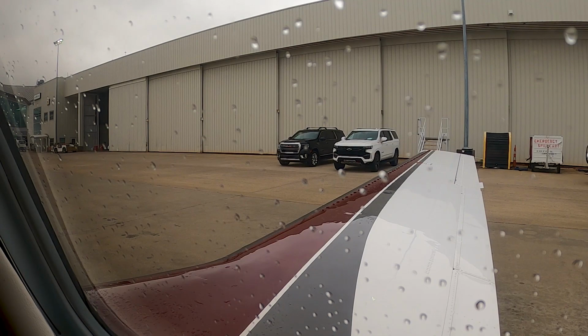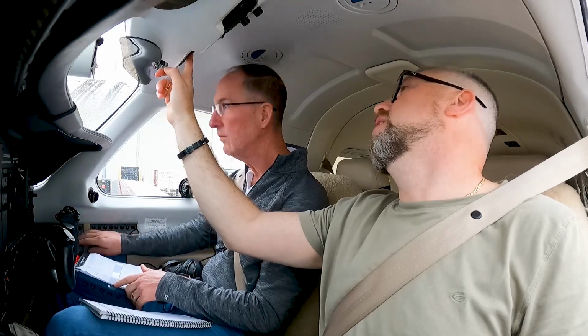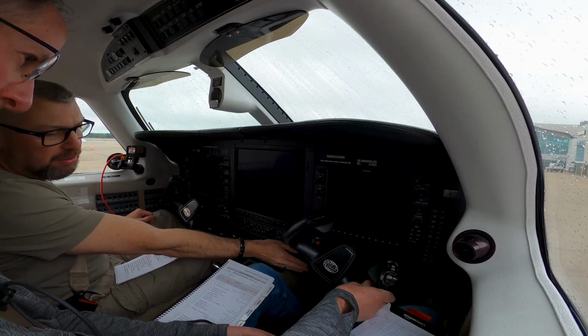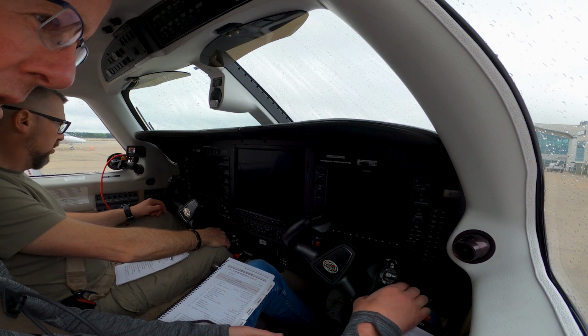All right. Chocks, plugs, covers, cuffs removed. I did remove all of them. Doors closed and latched, and passengers well briefed and non-existent. O2 quantity verified. It is black. Good. All switches off and all breakers in. The only light I see is nav, which is okay. Environmental is off. This has to be in the middle. It's the middle. This is off, this is off, this is out. Circuit breakers right.